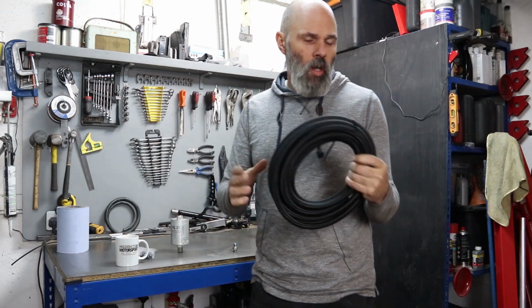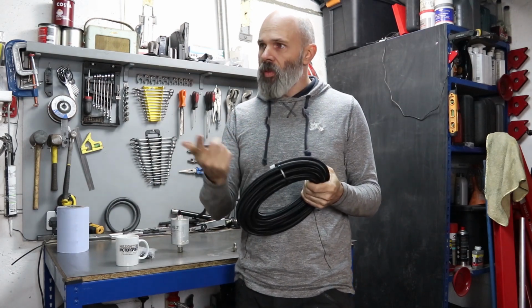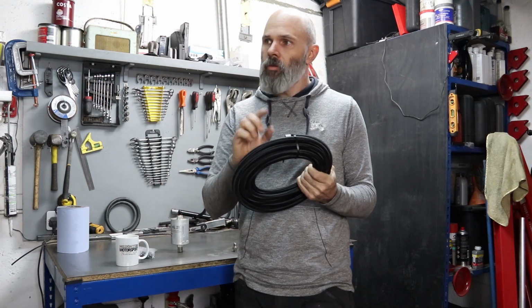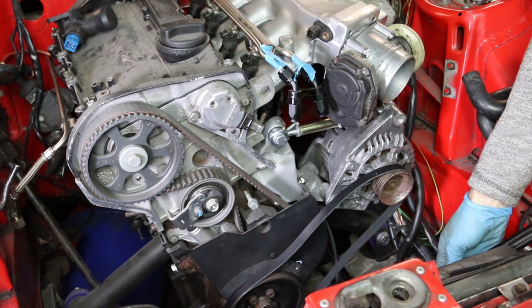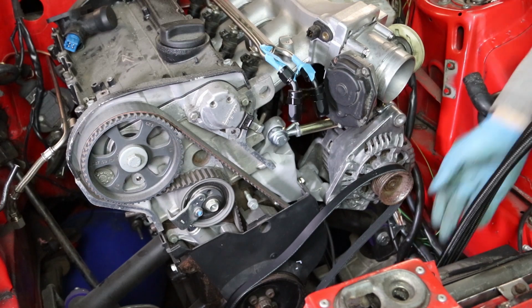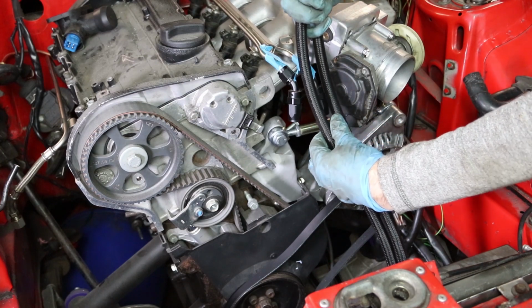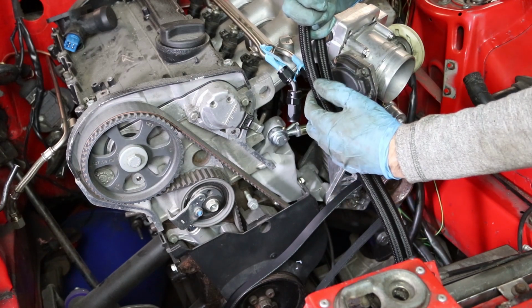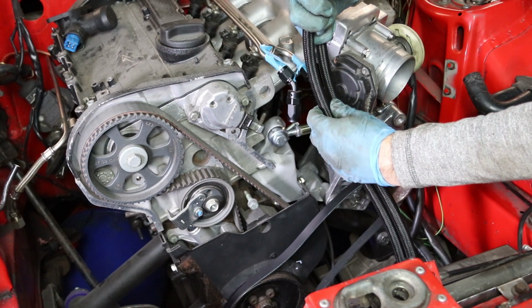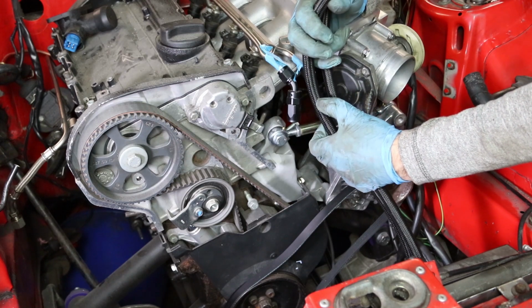Yes, I know. So what I'm going to do next, now that I've got this hose, this is going to be for the feed line, so I'm going to get this run down underneath the car alongside the other one, and then just work out the lengths. So I'm going to mark this. I'll just put some red tape on just to differentiate it from the other one. Okay, so I've currently got the hoses coming out of here, and then essentially they'll wind back up to there-ish, obviously making sure that they clear the belt and the fan and everything else. So if I say, I think probably cutting them about there, there'll be room at the back, so if I need to lose any excess.